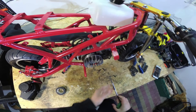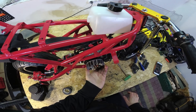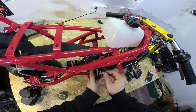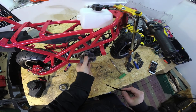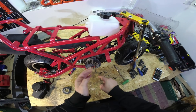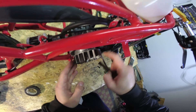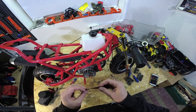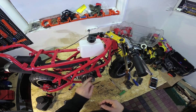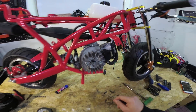Now when we've tightened that up, you simply twist the flywheel and remove the tape. That tape actually gives you the proper space between the coil and the flywheel. As you can see when you turn it around, it is not touching the flywheel in any place and it is also very close to the flywheel. So using the tape like that - this is the best method to install the coil and you can be sure that the space between the coil and the flywheel is correct.